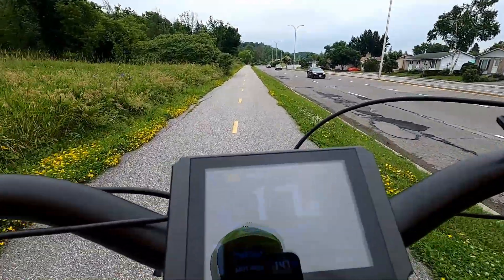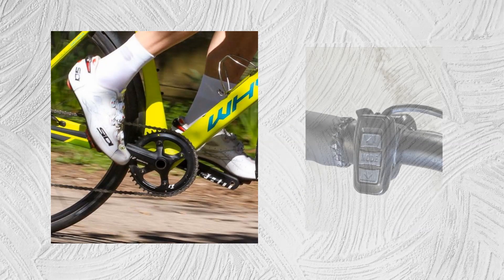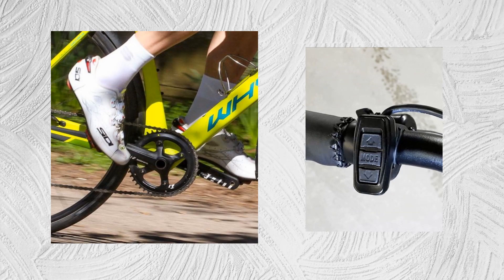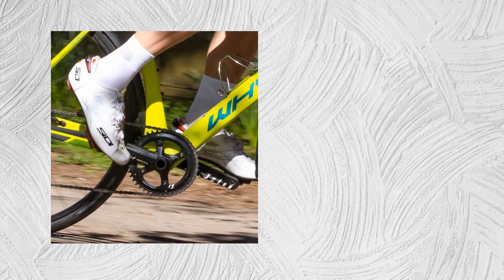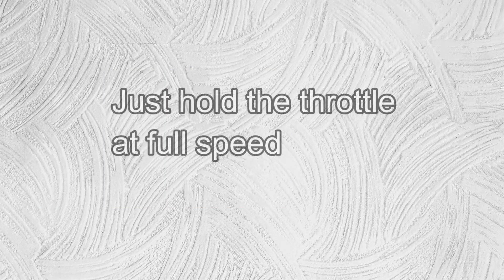Once the desired speed has been set, unless you're going down a hill, the bike will ride within about one kilometer an hour of the set speed. You can operate SCC either with the pedals or with the throttle. With pedaling, use your selection buttons to choose a power level a notch higher than what you think is needed for your programmed speed and turn the pedals slowly — you don't need to apply any force. SCC works equally well with a twist throttle or a thumb throttle. In both cases, you ride at full throttle all the time and the bike won't exceed the selected speed. With this method, when the bike reaches its set speed it stops accelerating, then the controller turns the motor off until it slows a bit, then back on, until it reaches the set speed again.